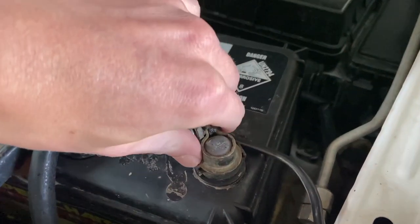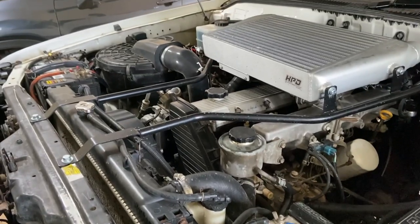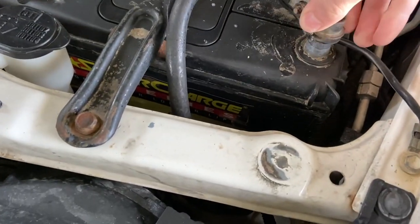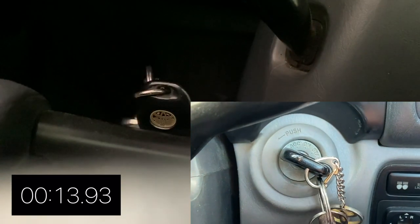Start by disconnecting the negative terminal off all of your batteries — if you've got two or three, disconnect all of them. After about three minutes, reconnect one; I did this on my main cranking battery. Once the terminal is on, you've got 20 seconds to put it into programming mode. Jump in the car, close the door, put the key in, and go from accessories to on and back 20 times, finishing in the locked position. I finished within 12 seconds the first time and for some reason it didn't work, so I tried again.